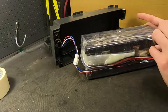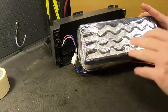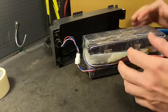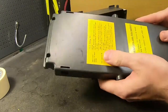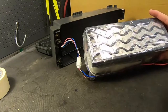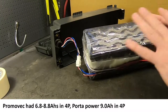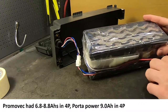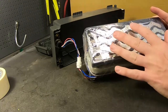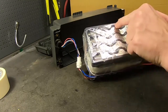This is an example of a very strange but very well-built battery pack that will last you a long time. They are using 5P so that the customer gets at least 10 amp-hours — that was a 26-volt 9 amp-hour pack. Most ones using 18650s back then were using 4P, getting like 6 to 8 amp-hours. So I really like this cool design, but it's almost impossible to replicate without these nickel strips.